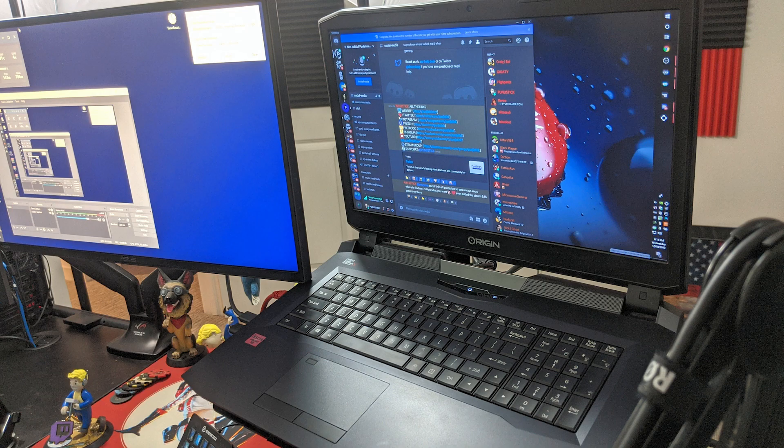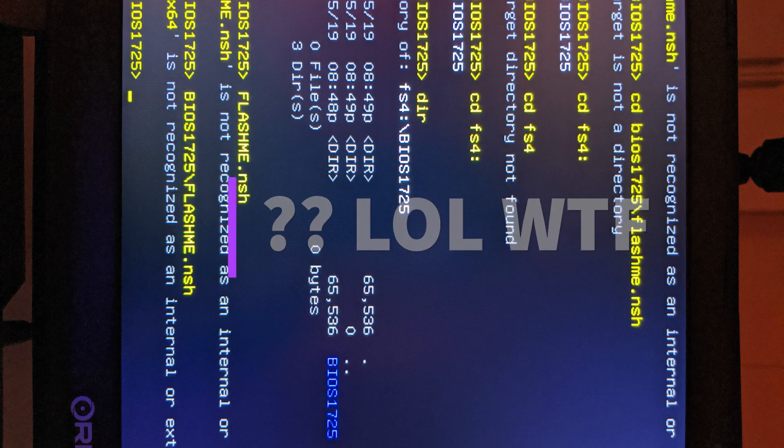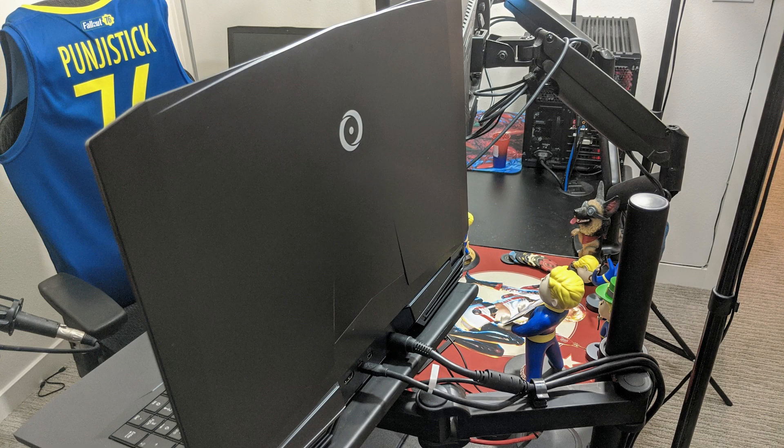I didn't get any fancy treatment just because I'm a washed up Rainbow Six Siege commentator that plays video games for a living. I called their tech support line just like any other customer, and a friendly dude named Sam walked me through the whole process via phone and email, even sending me all the files and instructions I'd need to flash the BIOS to be compatible with the new RTX 2080. Before I actually swapped the GPU, I first had to flash the BIOS twice incrementally to get the laptop to detect the new card. I had no idea how to do this, but their tech support made it a breeze. I'd never flashed a BIOS before, or swapped a laptop GPU, or even heard the word FreeDOS before. The instructions they gave me were incredibly simple to follow. Once I was done with that, I just ran Display Driver Uninstaller, shut it down, and started the swap you're about to watch.